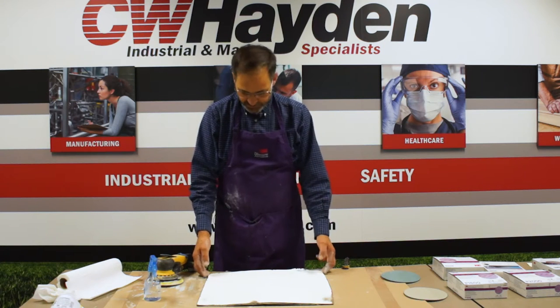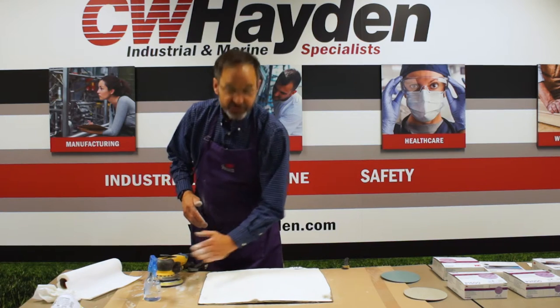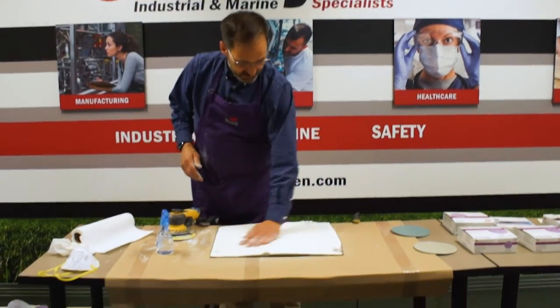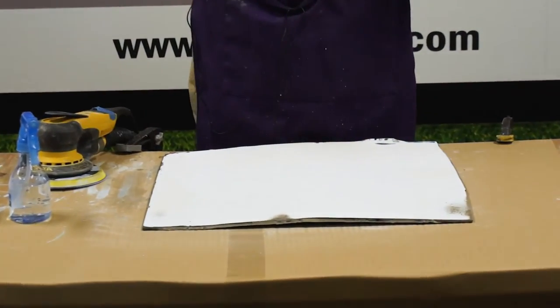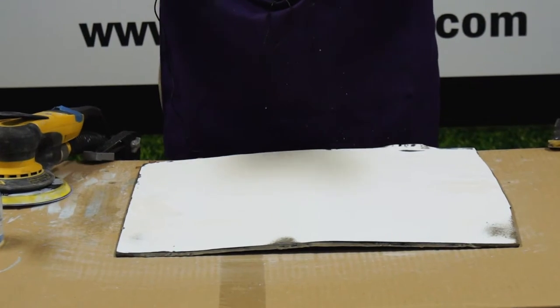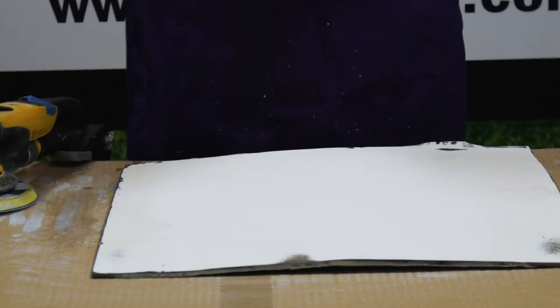I have a painted steel panel here that I've unfortunately sanded through because it was very uneven, so I'm going to work in just the center of it. You can see right now that it's flat white — it's a urethane paint. My first step prior to this operation was sanding it to 400 grit to get a flat, uniform finish suitable for paint prep.